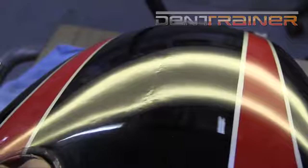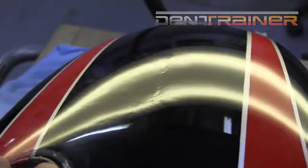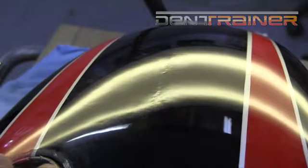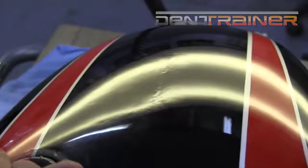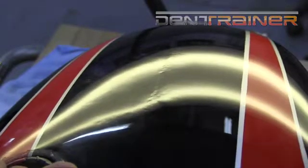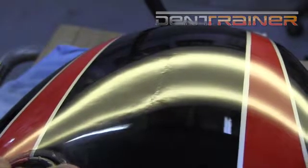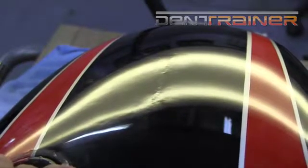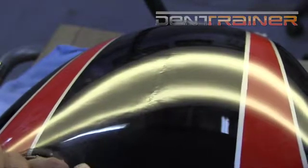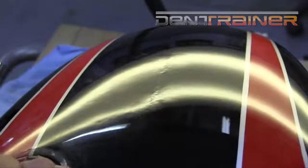And there's my pushing technique here. Again, we're going to pinpoint that crown. Now what I'm doing here, I'm looking at it and trying to find every single little hole that I have in there, essentially a little bitty low or a little bitty dot, and I'm going to pinpoint it and push every single one of them up through the top of that crown. I'm going to go through the front of the tank, the middle of the tank, but my main focus is going to be on that crown. Really got to tighten it up.